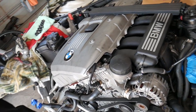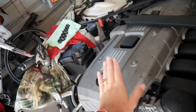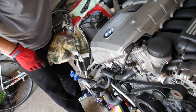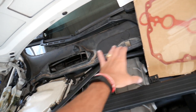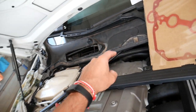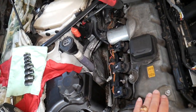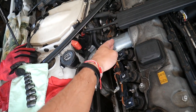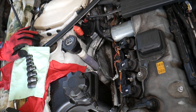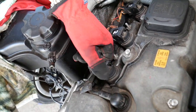Now we need to start on the valve cover gasket. First, we need to remove the engine cover. On the 3 Series you'll have a cowl trim piece for the windshield — check our channel for how to remove it. Once you do that, you can get to the valve cover. The valvetronic motor is right here on some models. You can also see the ignition coils. Now we need to start removing the gasket, so first we need to disconnect all of the ignition coils.